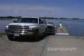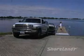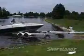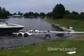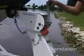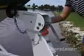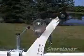Once you are backed in far enough and ready to launch, put the vehicle in park and set the parking brake. A properly adjusted trailer will practically launch the boat itself, so use caution, especially with roller trailers. First, grab hold of the winch handle, switch the ratchet mechanism off, and slowly let out line. Be careful here, because if your boat decides to take off on its own, it could pull the winch line and cause the handle to spin dangerously out of control.